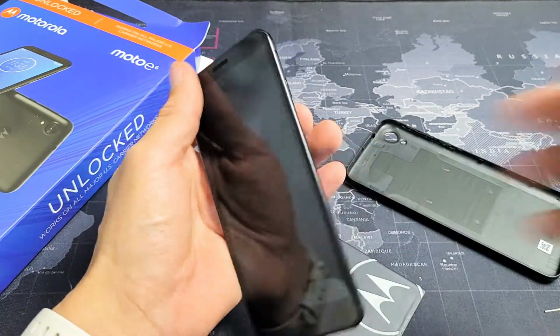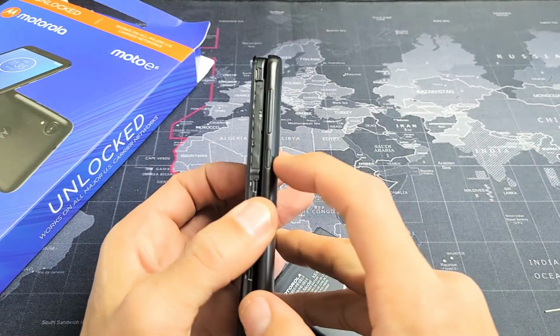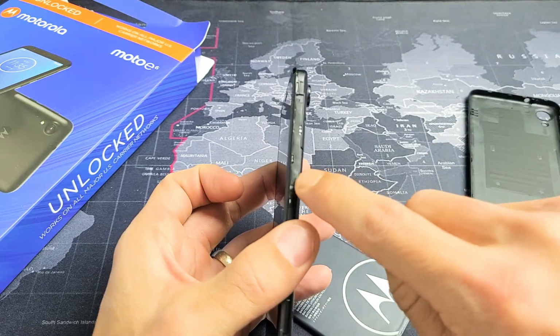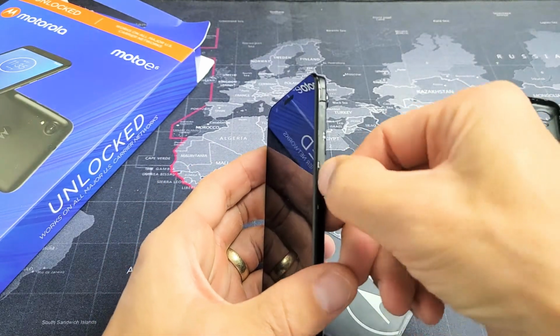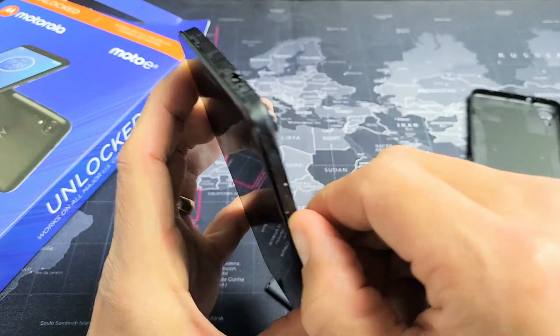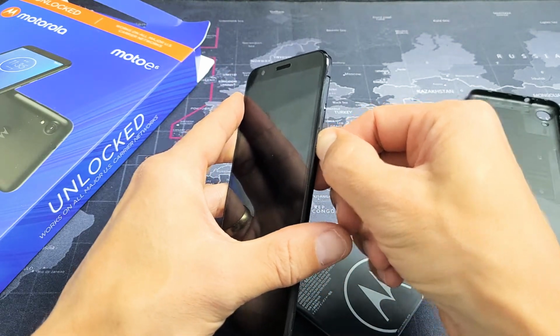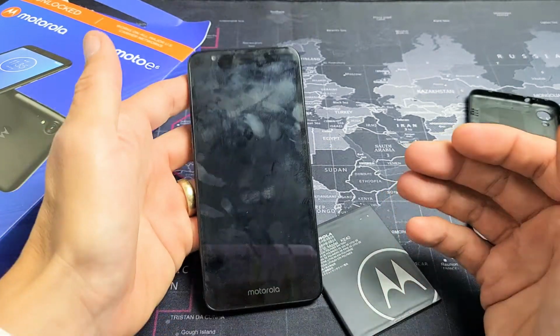all the excess battery. Now, if you look on the side, you can see where the power button is and the volume rockers. You see the power button is right here. It's just a flat area, but when you press in, you can feel the power button, okay? What you wanna do is press and hold this power button for 30 seconds while there's no battery in there, okay? After 30 seconds is up, let go, reinsert the battery, boot up your phone, and then see if you still have the black screen.